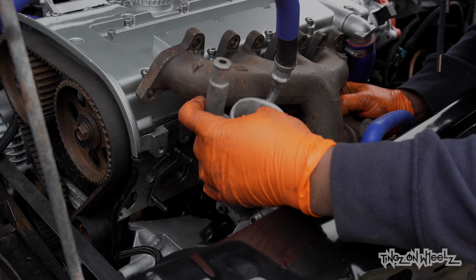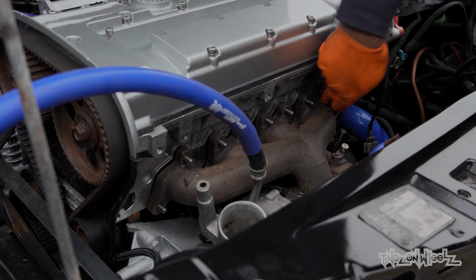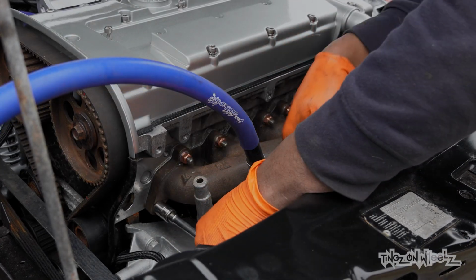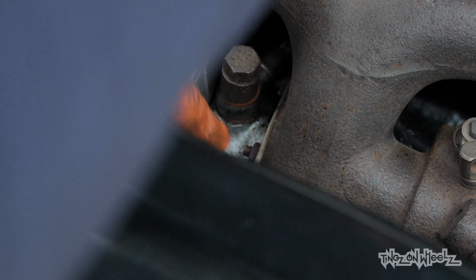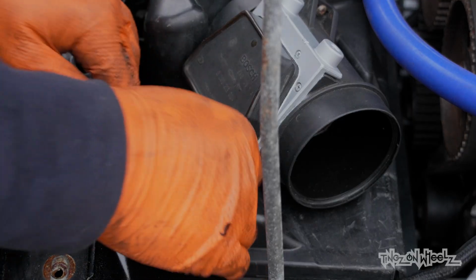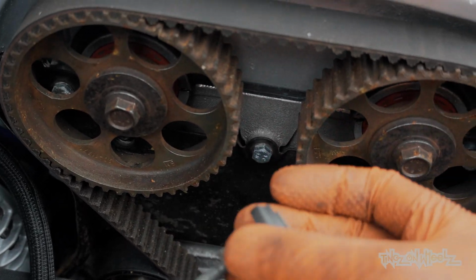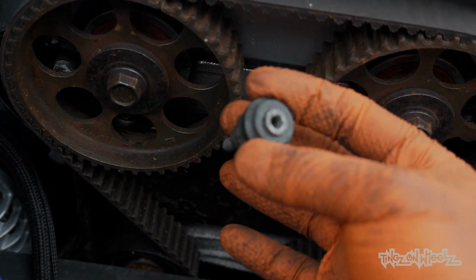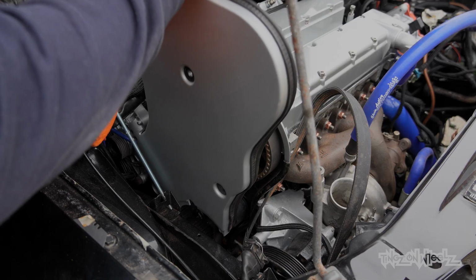As I got some new exhaust manifold studs, followed by a gasket, turbo, and new nuts. Those old style ones didn't make the cut and look prone to rounding out, making sure I don't forget those oil feeds and return lines underneath. Airbox slots in, although I want to replace that as it's got a broken tab. So that's wrong. It actually needs to be that, so the cover can screw onto it. Let me sort that out.